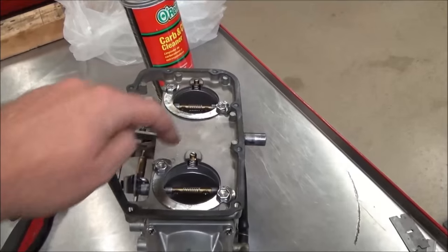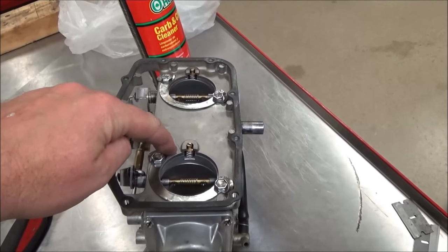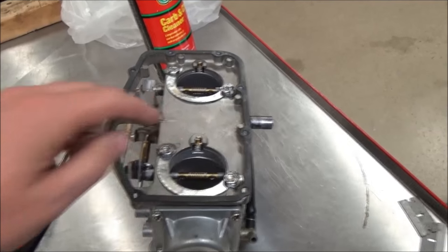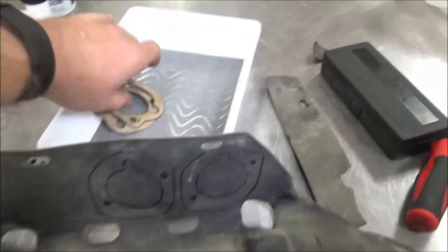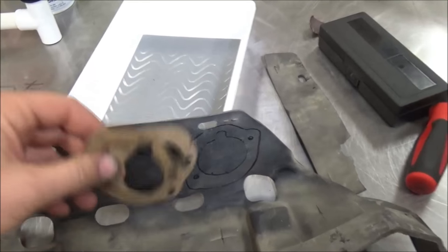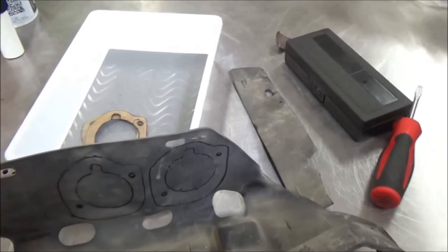To fix that, I'm going to try and see if I can't unstress this plate and bend it back — that's really hard because this is cast aluminum, it's just going to want to break. The better solution is I'm going to make some of my own gaskets. I tried paper ones first and they were too thin, they still didn't work, so I'm going to try some thicker rubber.